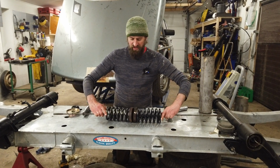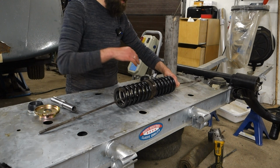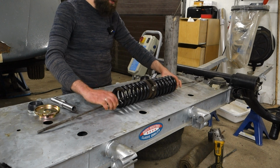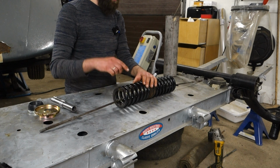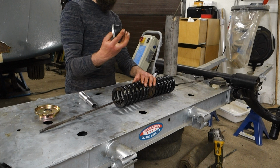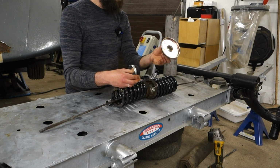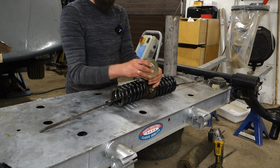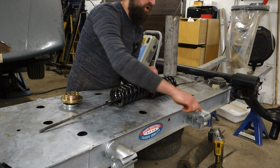So this is just sitting inside of the box and are able to spring the front axle and the rear axle. And they are not really interconnected in the cylinder or with the springs itself. But on the outside, this piece of piping is attached with this rubber donut that is pushing against the end cap. This is the end cap that I'm going to weld on the cylinder. It's pushed against that. And then everything is suspended between these 2 points on the chassis.